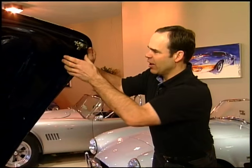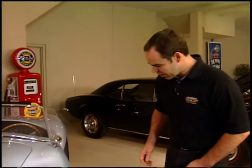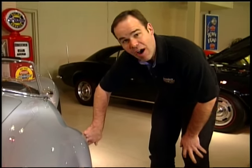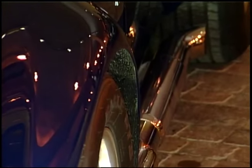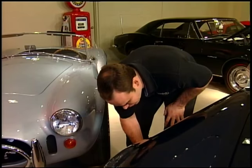Under the hood, there was originally a round tube which the aluminum was riveted to. If you've got a frame like this, you know it's not the real deal. The next thing to look for, as you can see walking up to the car, is that the original body is actually wrapped around the wire — the aluminum gets wrapped around the wire. On a fiberglass car you can't do that; it can't release from the mold, so it just folds in and doesn't wrap around.